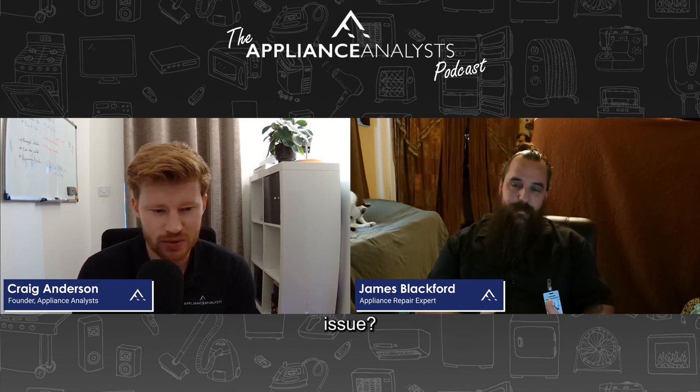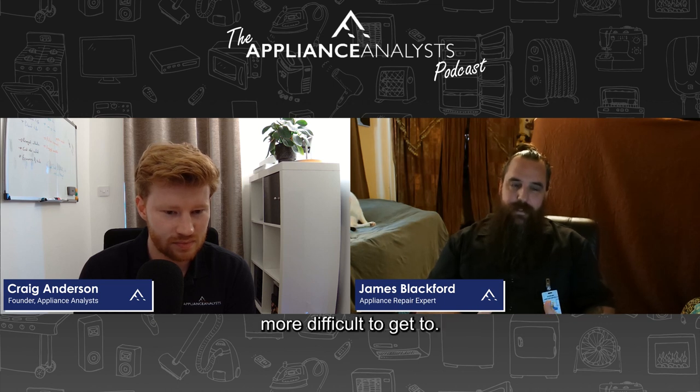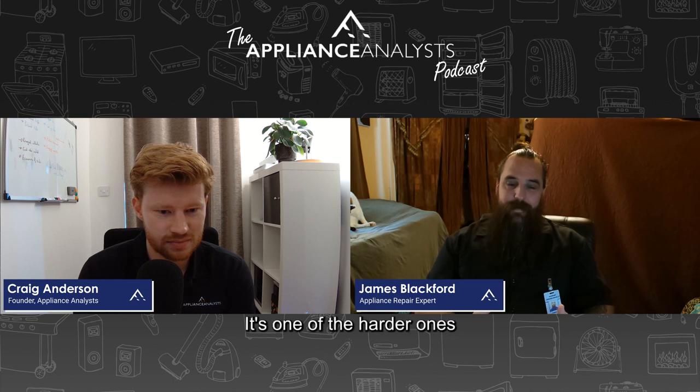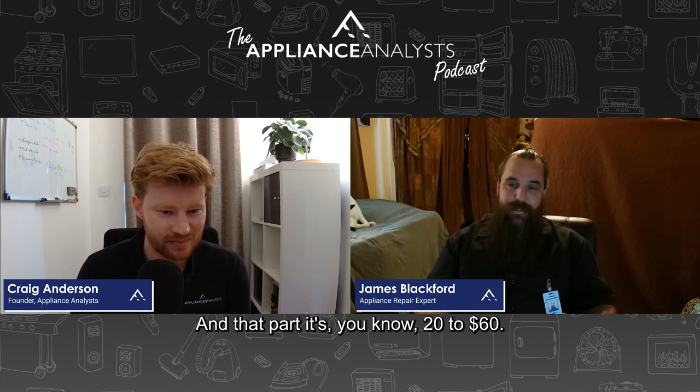Yeah, interesting. And is that typically a water supply issue? Yeah, that's typically the water valve. And again, that can usually be accessed from the front. Some models are a little more difficult to get to. This is a case where Samsung is definitely the culprit. It's one of the harder ones to change the water valve. But as far as the valve itself, it's typically just one wire connection and then the water connection.